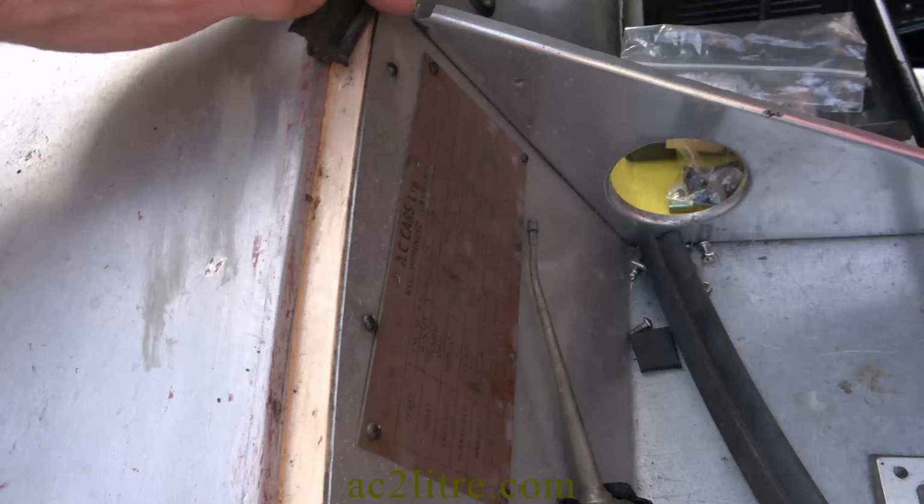Some new chrome fittings for the bonnet. I also have some fasteners such as these square quarter Whitworth nuts. Brass 3BA screws for the fuel gauge sender, a fastener set for the front grille including aircraft style floating anchor nuts with 4BA threads, more special aircraft fasteners, thin self-locking nuts and double coil spring washers for the rear mechanical brake expanders, some stainless 2BA screws and nylocks mainly for the accelerator link brackets on the bulkhead.